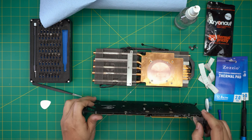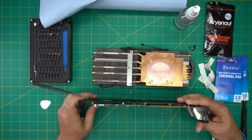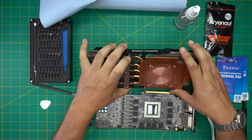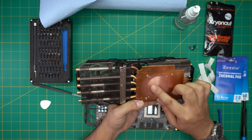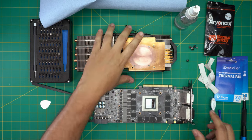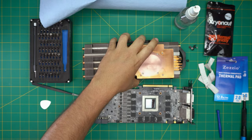We're not going to remove the back plate right now, but I'll show you — we're going to use the back plate because there's a little space in there you want to fill with a thermal pad. That way it can absorb a little more heat from the VRAMs and the GPU, making the back plate more useful than just structural. You can use existing thermal pads or grab new three millimeter thermal pads — that's more ideal. Now I'm going to take it outside and blow some air through the fins to clean them nicely.